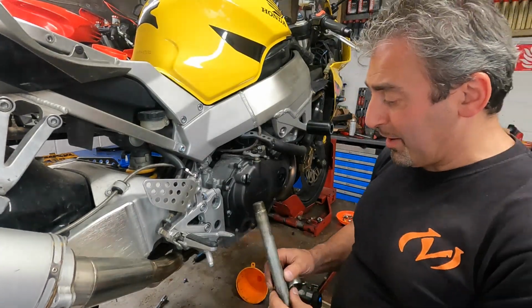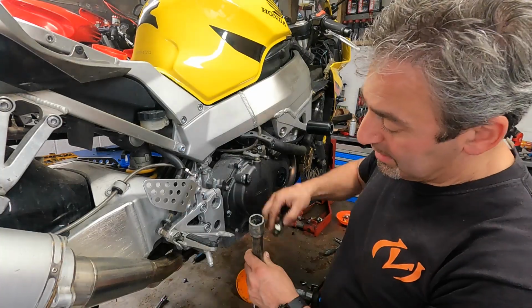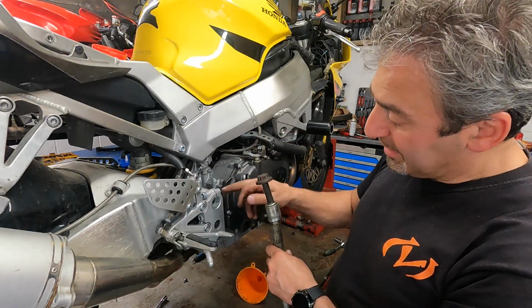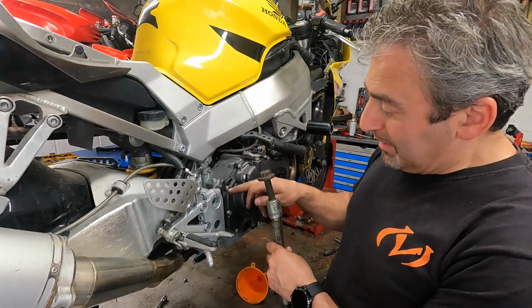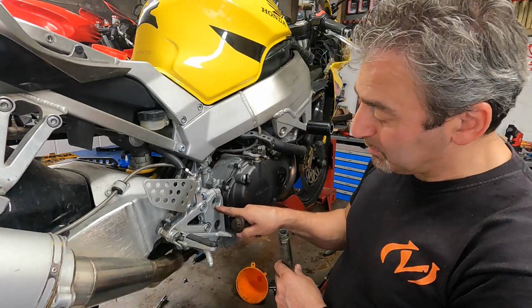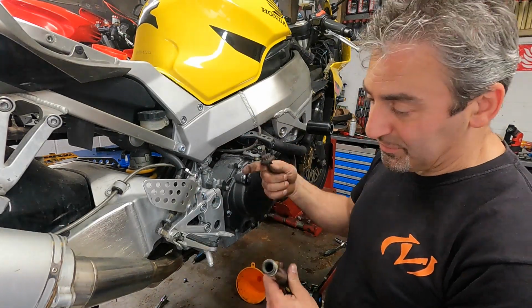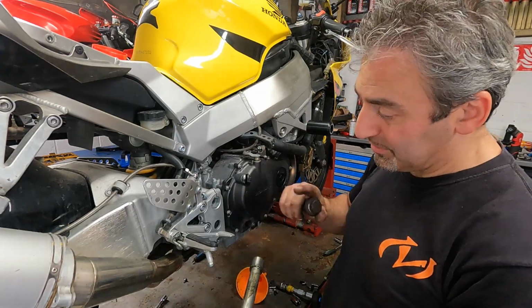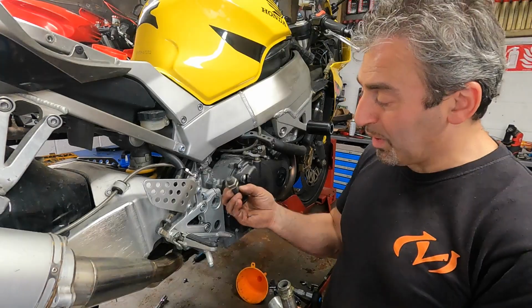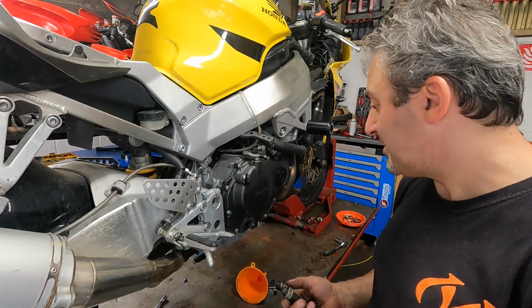The replacement one came out with a spindle and a socket, so you can see what it looks like. So the tool will go in there, undo the end nuts, which is here. There's a pinch bolt on both sides, so we'll undo this pinch bolt so we can undo the nut, and the bolt will be held in with the other pinch bolt, so you don't have to hold both sides. And then once that's free, we can punch it out. Right, so I'm going to go weld that, and then we'll come back and try and assess how we're going to lift this.